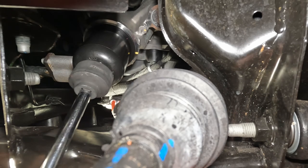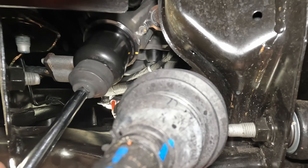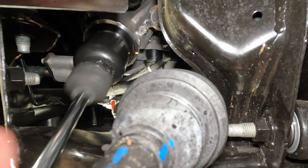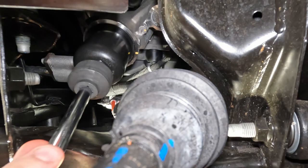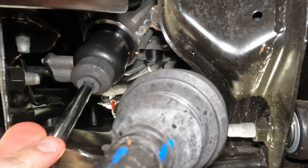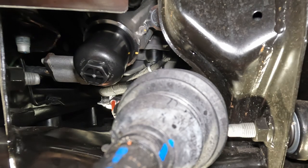Make sure you put oil on those O-rings so they slide on easily, since they have a very tight fit. As I get close to the housing, I'm going to switch from the ratchet to the torque wrench — this is very important, don't skip this step. I know everyone who works on cars is guilty of doing this, myself included, but don't skip it. I have this set to 18 foot-pounds. Check one more time — 18 foot-pounds. That filter is now properly installed.